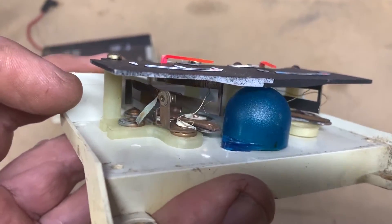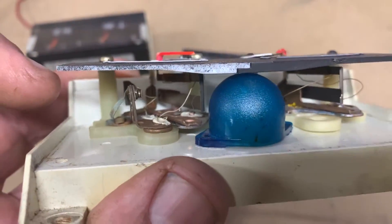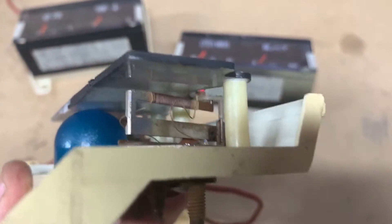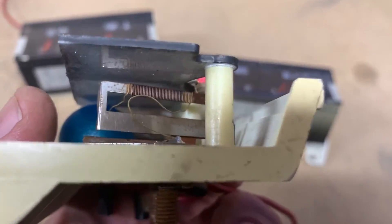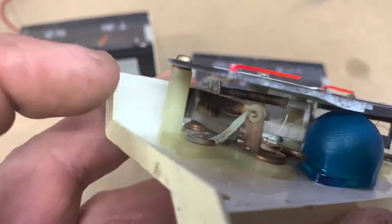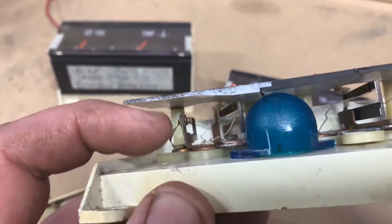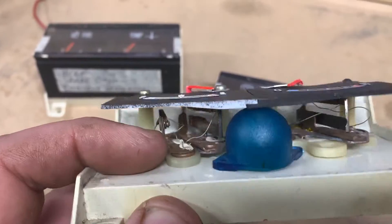After 40 years these do tend to fail. I've seen plenty of these gauges get burned out. What you'll see once they're burned out — all the mechanisms here, see how that's slightly discolored? That's still fine; these gauges work perfectly and have all been tested. But a burned-out one will just char black. If you see these charred black inside, that means they've burned out and the resistor has failed. So what you'd be doing is cutting that little metal strip there, which effectively bypasses this regulator before it fails and fries all your dash gauges.